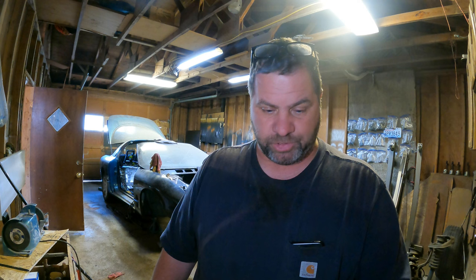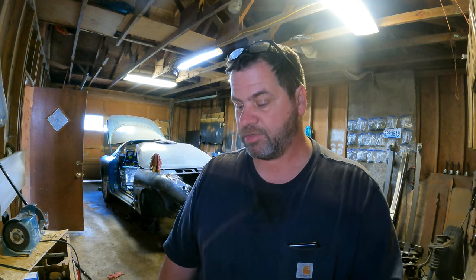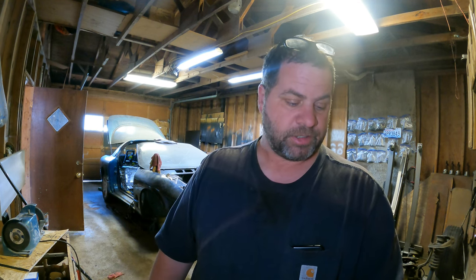So now I've got part of the easy out stuck in there, which is hardened, and my titanium drill bit won't drill into it. So I think I'm back to needing a welder to get this one out. So I've got one stuck in this head and one stuck in the other head. So I mean, I am ahead of the game from where I started, but I think I'm going to need a welder unless I can, I don't know, go buy a new drill bit, a sharper drill bit, and see if I can drill into that, which, knowing myself, is probably what I'm going to do.